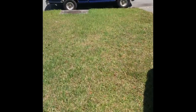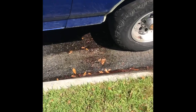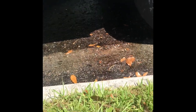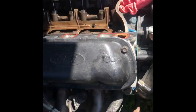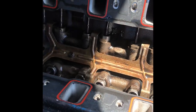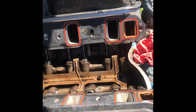This is my daily driver right now because that other car has been sitting for about a week leaking oil and transmission fluid — it's got a bad rear main seal leak and needs brake pads. I can't really afford for this thing to be down more than a day right now, so I'm going to go ahead and just do the intake for now. I just got the intake off and it's pretty clean inside — happy with that. The intake gaskets were probably the reason it was leaking; those were just ones I had laying around that were oversized.